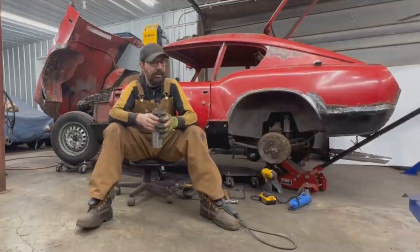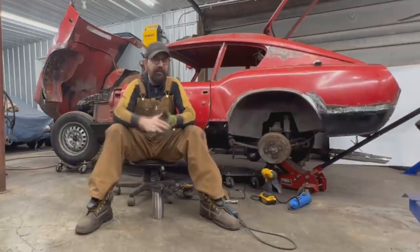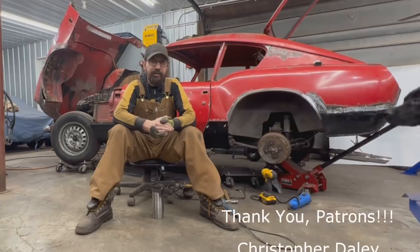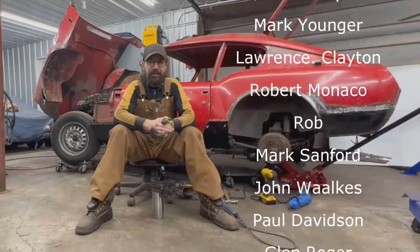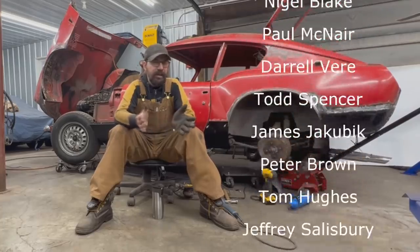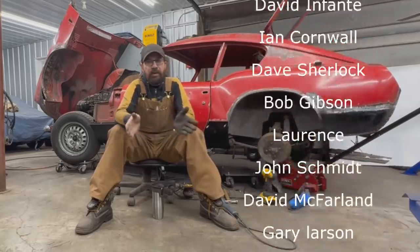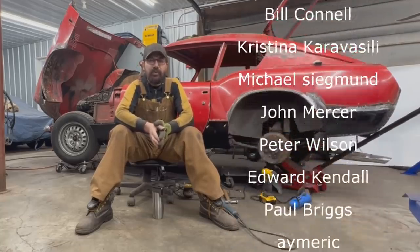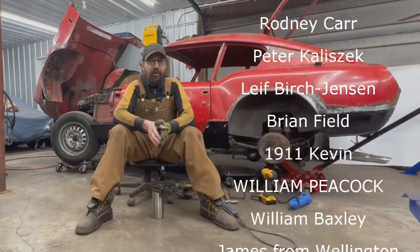Now we can repair this piece here to match these two, because that's our reference now. In this situation we can start repairing our floor, inner seal, strengthener piece and everything, but we can always refer to these outer panels as they are — that's going to be our memory stick. That's what I was aiming for today. It took a whole entire day but I'm happy that we have this part completed and all the internal repairs can be done without worrying too much.